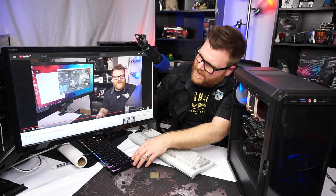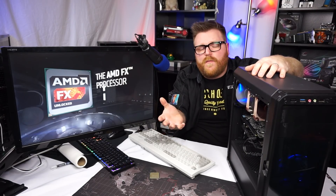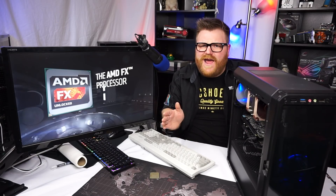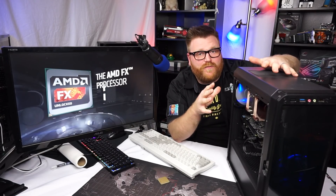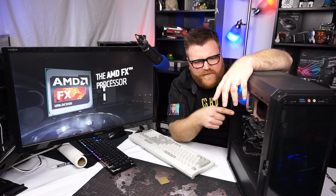We're lucky stars we have Ryzen now. I know this was supposed to be a short video but we did accomplish some stuff. I proved that some high-end AM3 motherboards can be flashed to a BIOS supporting AM3 Plus — it didn't work before, it does work now. Also, if anyone has an FX 9590 — the Piledriver 5 GHz version — I'd love to get one, maybe even pay for shipping, to put it on this very good motherboard and do an extreme outdoor minus-40 overclock. Looking forward to seeing some extreme overclocking with this 8150, maybe hit 6 GHz.